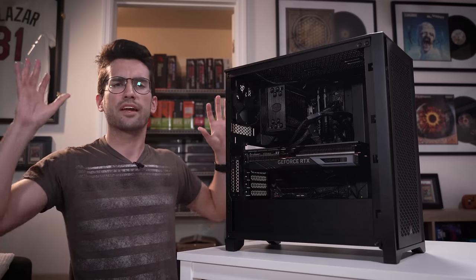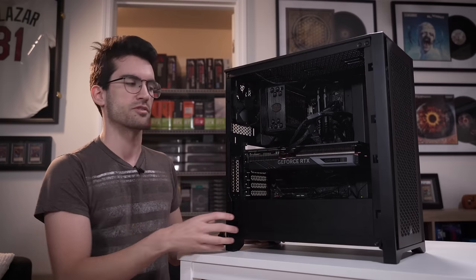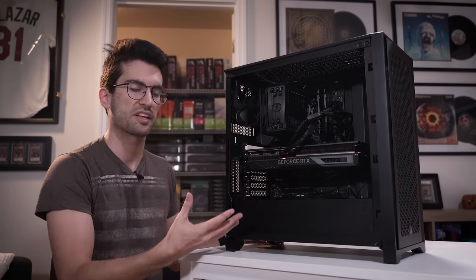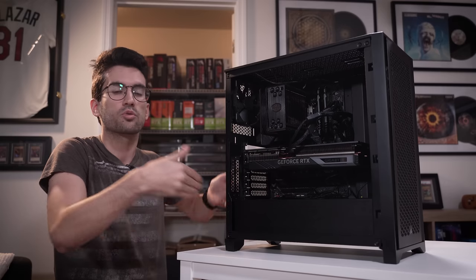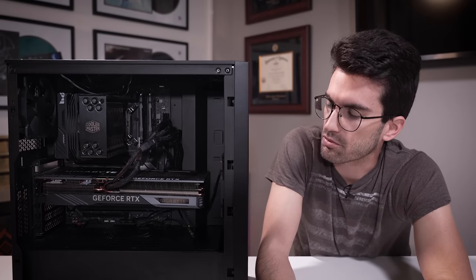Let's kick things off with a quick recap of what is wrong with the rig before we attempt to power it on and replicate the issue described. That being, an amber DRAM LED light, very persistent, and prevents the system from posting. So we should expect to see the rig power on, fans spin, LEDs turn on, but again, no signal to our monitor, which means this is just one giant paperweight. By the way, a few other things to tackle toward the end of the video, assuming we can get this rig up and running in the first place.